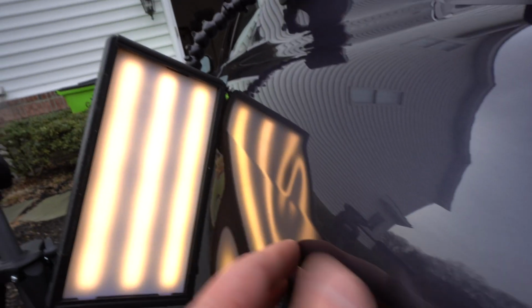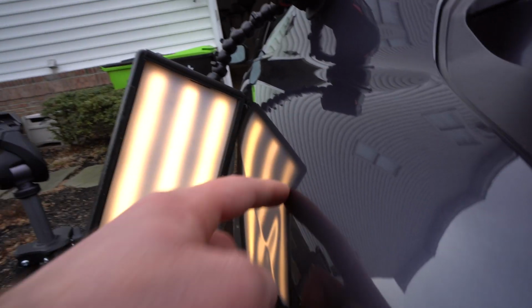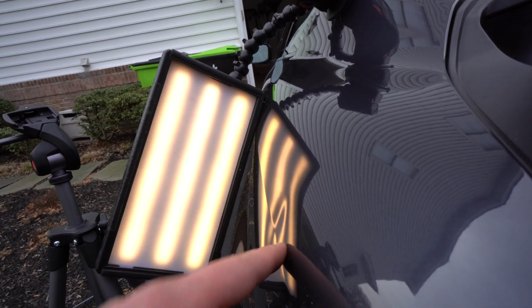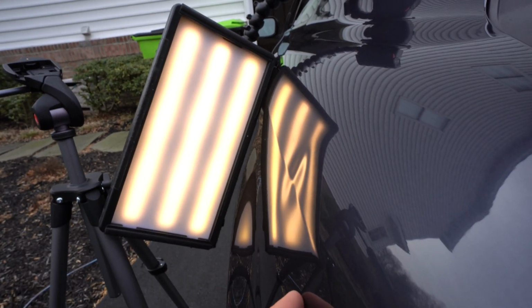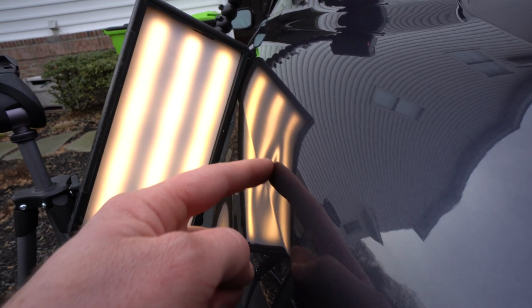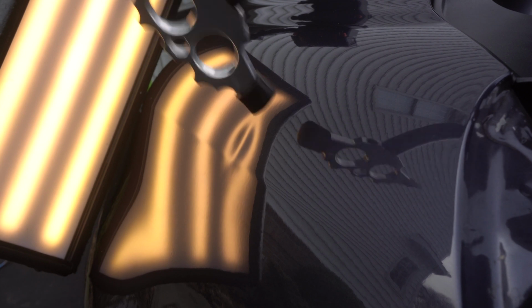So now what I want to do is apply the pressure from the back side on this dent and start tapping this part here. All right, so that's going to create the metal flow this way, that way, and you will see that this dent starts getting smaller in size. So just basically a little bit of pressure from the back side. I don't have to be super precise, just anywhere, as you guys can see, right there.